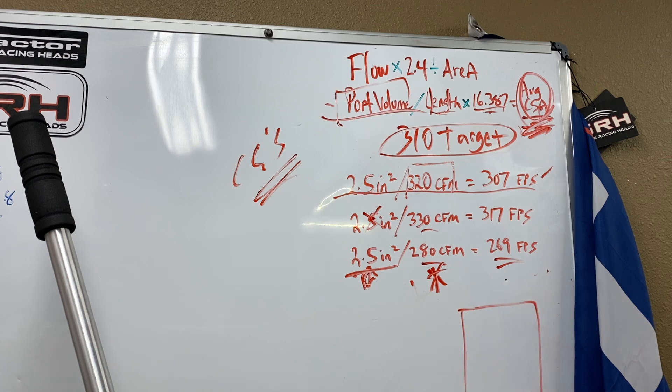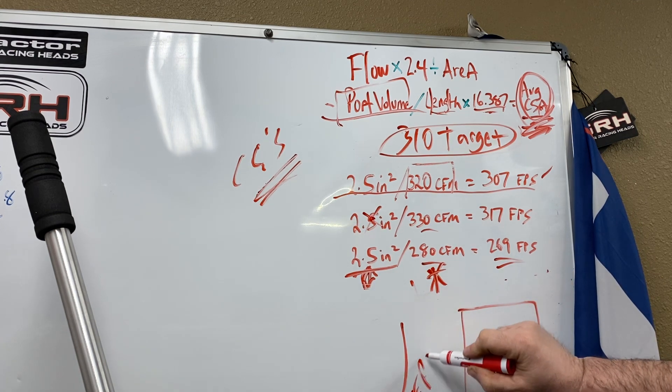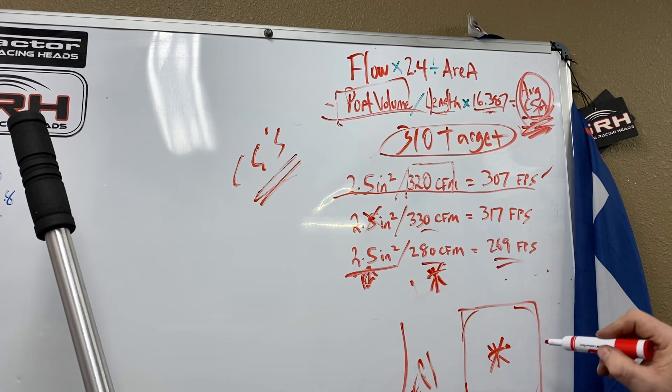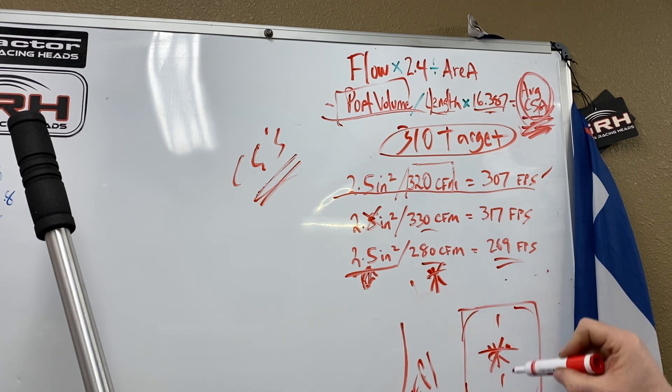Another thing: if you've got a two and a half inch area at the pushrod, you can't go back in the bowl and put three inches — it's got to be a balanced port. I use a J-tube in all my work. I've got cylinder heads I could put right here dead center from start to finish and they fluctuate 10 feet per second — that's a balanced port. What happens when you put filler in the corners? You speed that up.